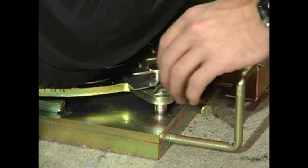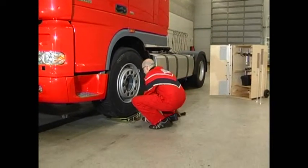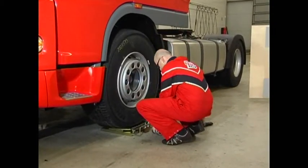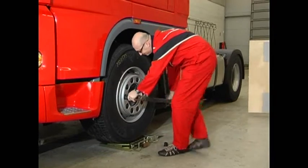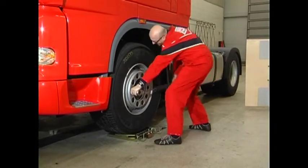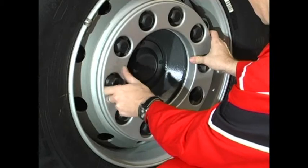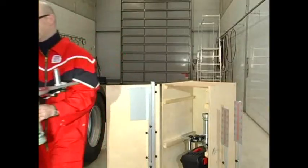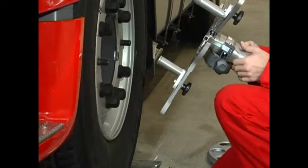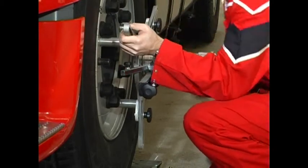Once you have driven the truck onto the turntables, you can remove the locking pin. The mounting device of the measuring head has three long holes to adjust the magnetic legs. The distance of the legs can be adjusted to the hub diameter. The magnetic legs of the measuring heads are adjustable in the distance to the center. These are to be adjusted to the diameter of the rim bolts in order to fit the magnets between the wheel nuts. Select the magnetic legs with the correct length depending on the depth of the rim and attach and fixate them to the rim. Make sure to apply the device only to clean points of contact.